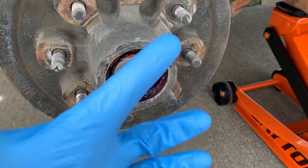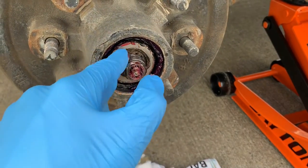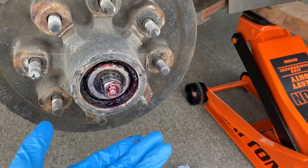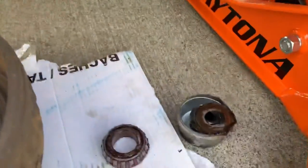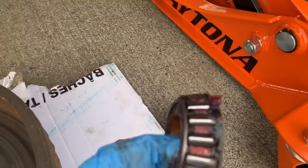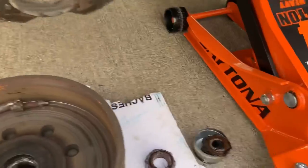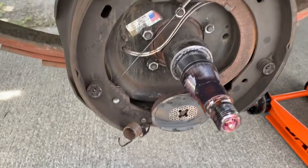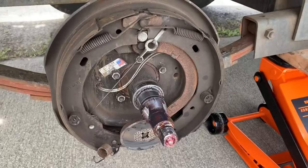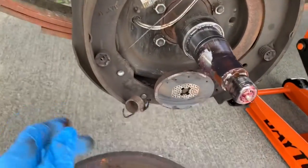For an expert - you want to wear some gloves because of all the grease that's on here. But right now you should be able to pull this off. When you do that, the bearing in here is going to fall down, so you want to try and catch that. Got it pulled off - you can see the bearing. It's definitely got some dirty grease on it, there's some clean grease right there still on the rest as well - pretty dirty. So definitely time to get the grease changed out in here. Also, I found this - you can see that spring there came loose, so that's no good. I'll show you guys what it's supposed to look like on the other side. Hopefully I don't have the same problem over there. But yeah, gonna have to fix that.